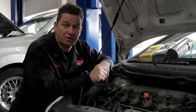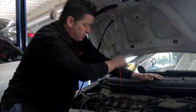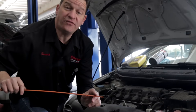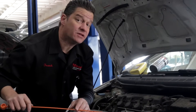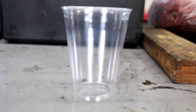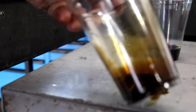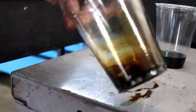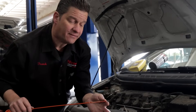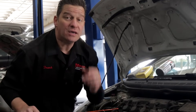You can get a lot of clues from the condition of the fluids. Let's take a look. Checking the engine oil is not difficult at all — look for the colored dipstick, pull it out, and make sure the engine oil level is full and not extremely low. If the engine oil level is low, that engine is going to be making noise. Check the condition of the oil as well. It should be a middle to dark brown color with no contaminants. If it feels really grainy or gritty, there could be contaminants in the engine oil indicating excessive wear. Also check to make sure the engine oil does not have any shiny metallic flakes — that's another indication that the engine is wearing badly and it may not be your choice buy.